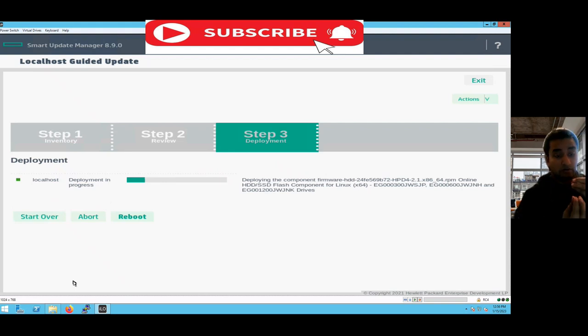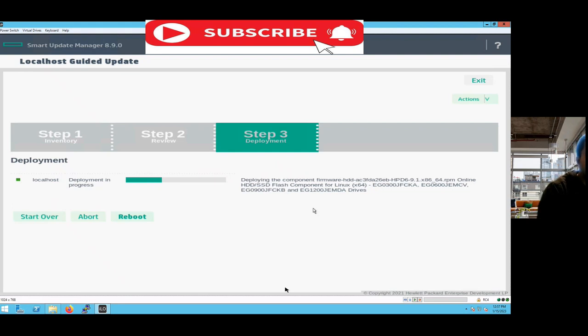the ILO console. ILO is a device, right? This is a device attached to your Ethernet connections. So that device is also updating. When it's updating, you're going to be disconnected because it's going to be reset. The ILO port is going to be re-initialized. So that's why you're going to be disconnected.